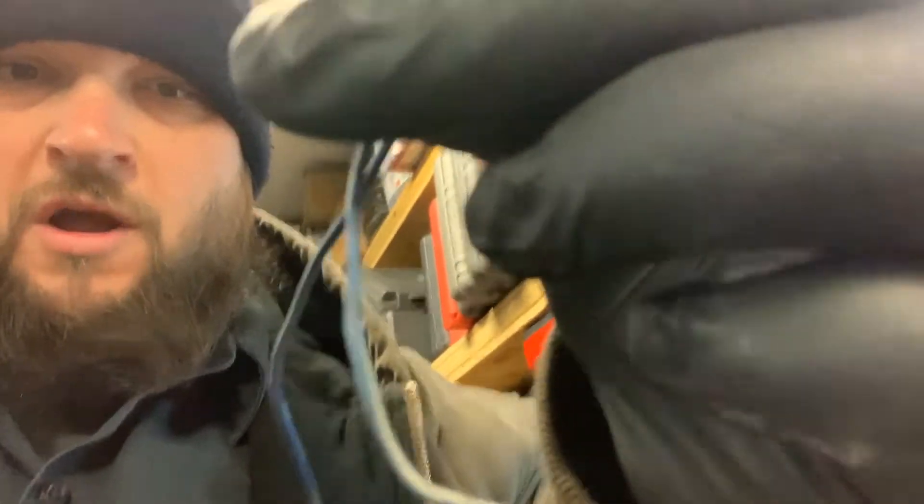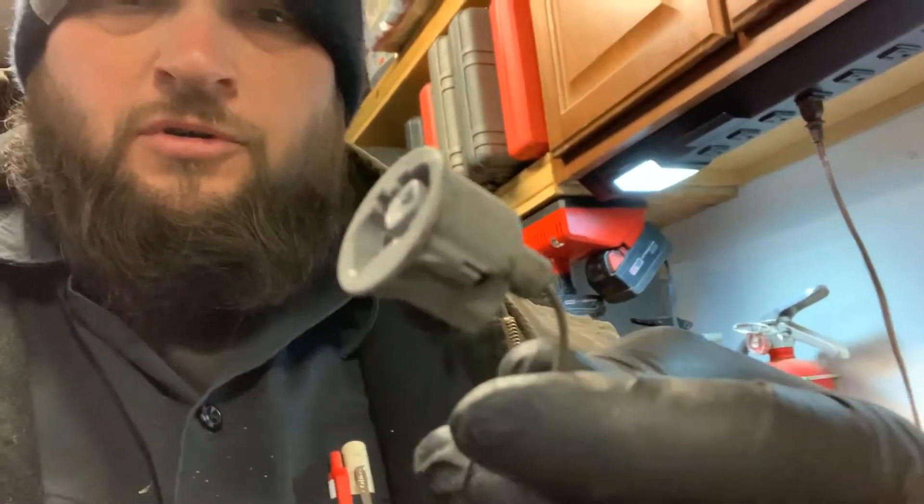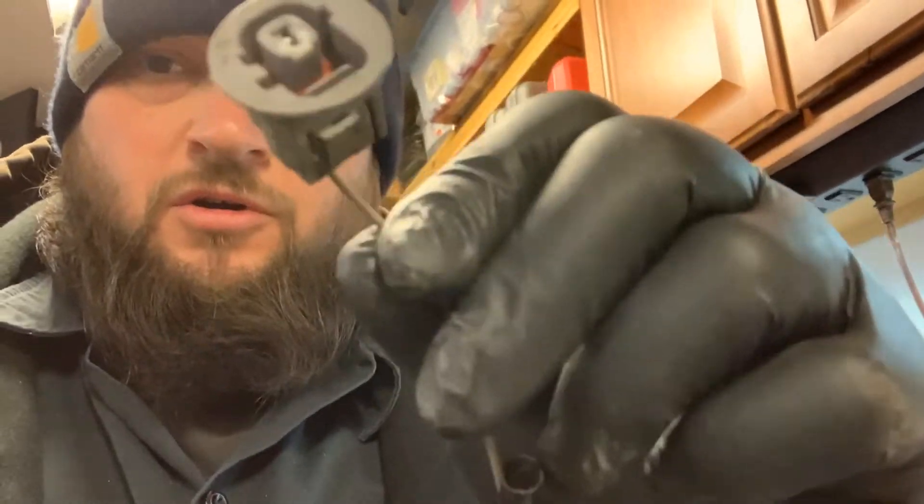If you're looking at a GTS harness and it happens to be cut, there are two little ground wires that bolt on the back of the cylinder head. There's a black connector with a blue-and-white wire and a blue-and-black wire — those activate the lift. And then there's a gray wire with a gray connector, and that is the oil pressure switch.